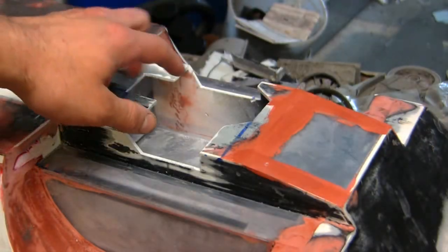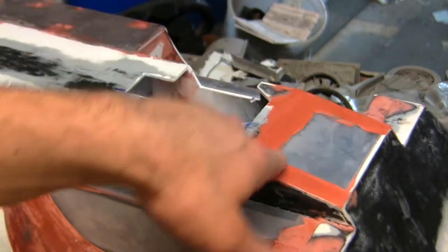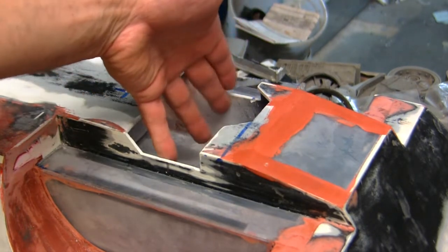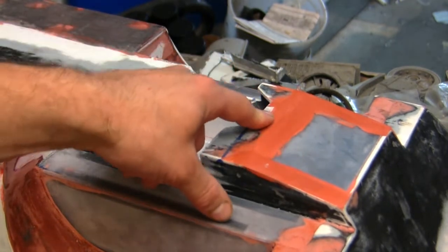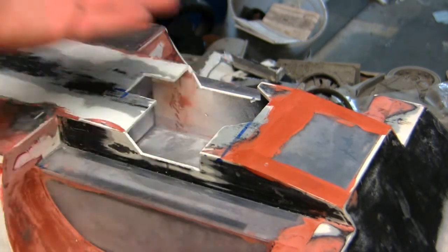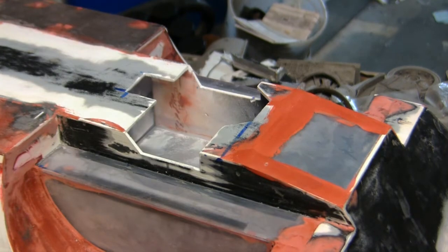During the procedure for the front well, I did suffer a little bit of damage on this plate over here. Nothing major, just some of the seams started opening up from me prying the plate in when I was trying to adjust the width. It wasn't a big problem. I already went ahead and repaired it with the adhesives. And from here, if you notice, I just added another coat of body putty. From here, or I should say off screen, I'm just going to go ahead and sand that off so that problem would be fully addressed.